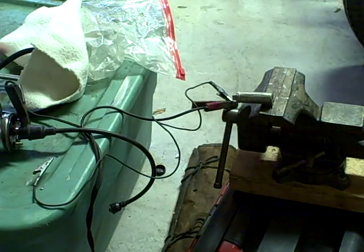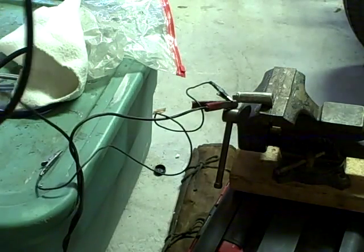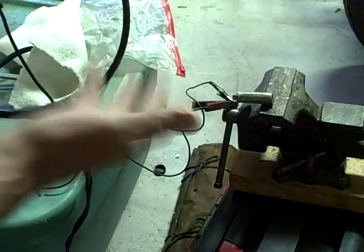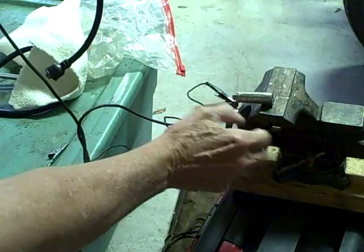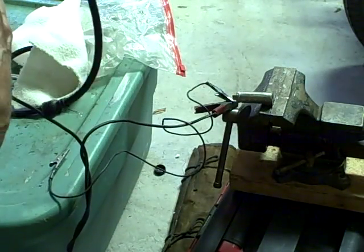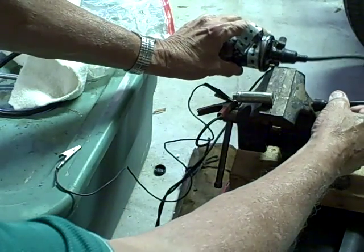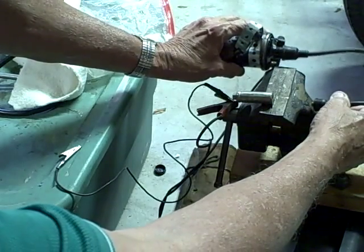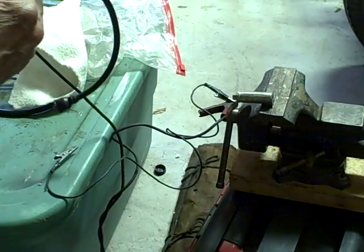In the continuing saga of Model A Ignition 101, I was playing with the car the other day and we thought the coil was no good because I couldn't get a spark out of it. I'll show you what I did that led me astray. I've got a battery charger here as my power supply — this is the ground, that'll be the car. I've got positive ground to the vise and the negative to the coil. If I touch this, that energizes the coil, but I get no spark. So we concluded that coil must be bad — but that's not the case at all.